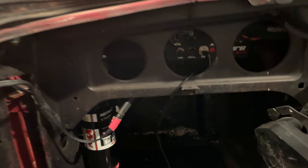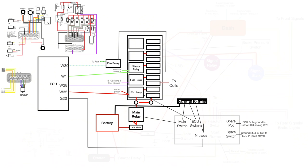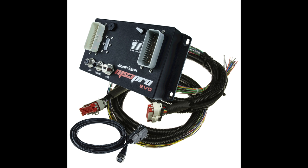The engine control unit will often have more wires than the rest of the car combined. I recommend thinking about the ECU wiring as kind of a separate thing. If you're doing a race car or something with a standalone engine management computer, you'll usually be able to buy a wiring harness specific to your application. Next week, I'm going to talk about wiring up a specific ECU, the Megasquirt, and that'll be helpful if you have specific ECU wiring questions, even if it's not specifically with the Megasquirt.